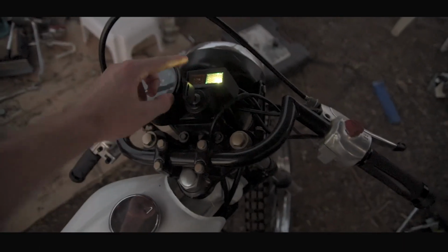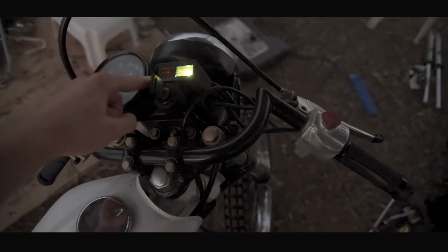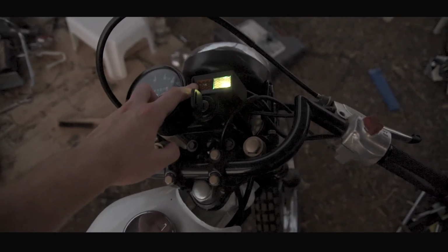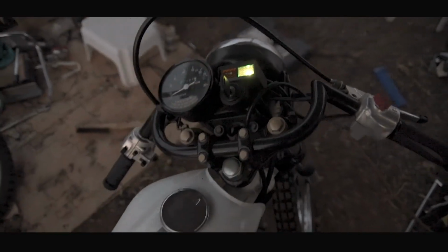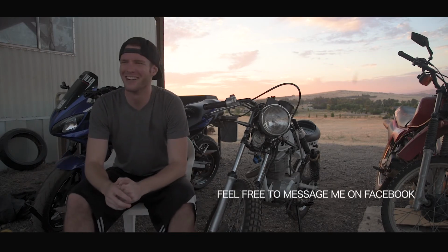As I said, the turn signal indicator bulb got taken out. I took that out and it solved my whole problems, all my issues. So I might try to get some LED turn signal indicator bulbs for that. It's a T10 bulb. You can buy those in LED pretty easily, pretty cheaply. So just stay tuned, I'll keep you guys updated on that. So anyway, the magical fix was actually basic wiring. That's just what it comes down to.